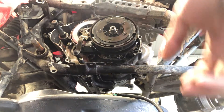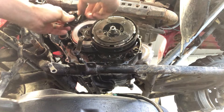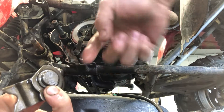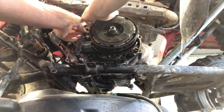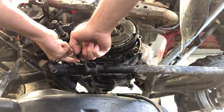We're gonna put the other piece in — this ball assembly falls out a lot of times when you pull this cover, so we're just gonna set that in there. Now you center this center pin into the clutch and that bearing. We set that there, then take this and just kind of rest it onto this arm here, making sure that this reverse gear is in place.